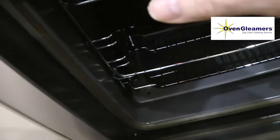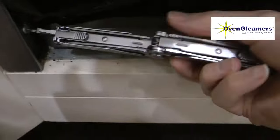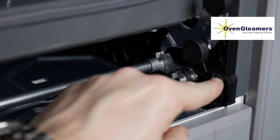We undo the side plates — that's actually a Leatherman with a hex bit adapter on the end — and take the two sides off. Step two: open the lock for the door spigot by pushing it up. Once we've got the side panels off, we can see the cover of that spigot lock and push it up. That means the door spigot can come out. Push those two up, and then lock the slider mechanism by turning the screw away from you. Now the door can be pulled off.